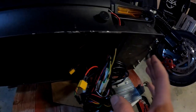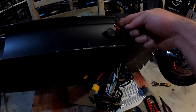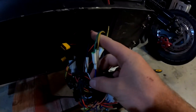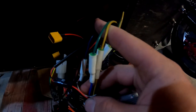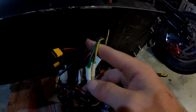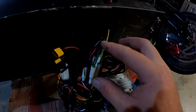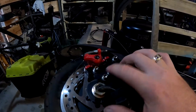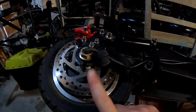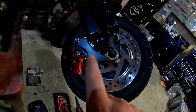It's easy to identify - just trace the wires. I know this one here goes into the back of the motor, so your back motor runs through here. Followed it through and it's basically these two wires here that go to the rear motor. Take photos to help you put the scooter back together. These connectors are easy to pin out - just pull them out. We don't necessarily have to do that for the rear because the rear brakes are up here.